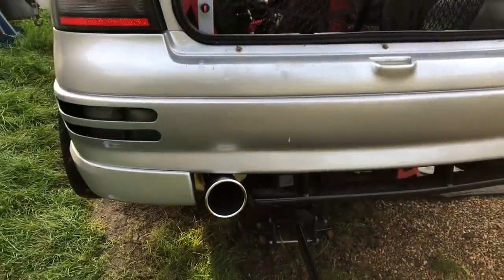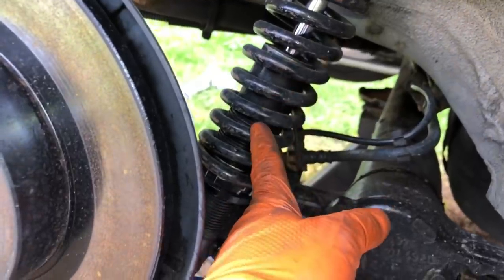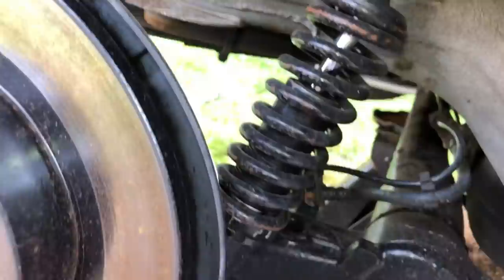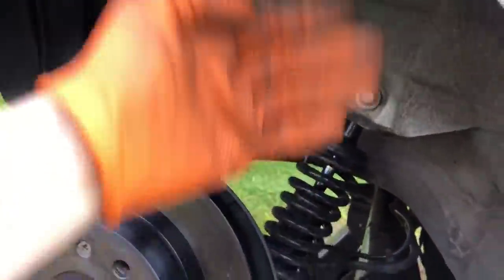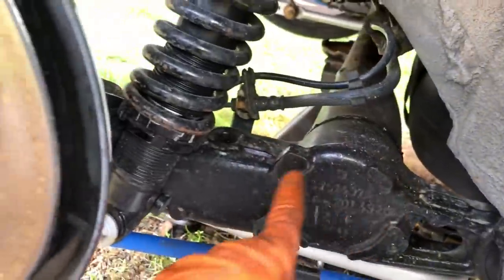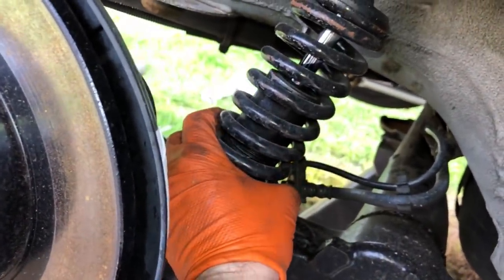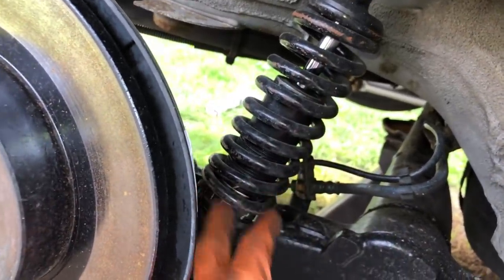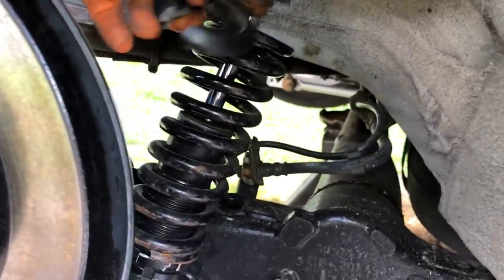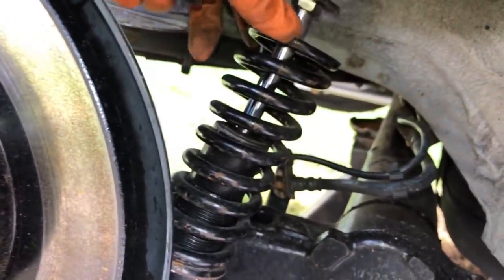I've adjusted the exhaust so there's now a couple of centimeters of clearance at the rear bumper, tightened up all the rubber mounts, and it fits lovely on the back. I also removed the rear wheel to measure the springs, as the spring rates on these GAZ shocks are absolutely dreadful — the wheel is going so far up into the arch it's cracking the arch spat. I'm going to order some uprated stiffer springs. They're six and a half inches long with a two-inch inner diameter, so that should be an easy spring to find.